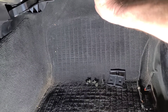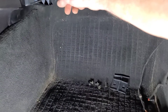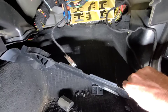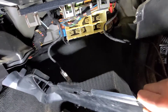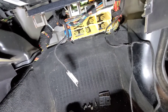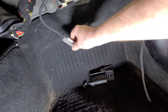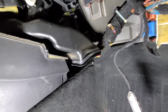Now we have to pull this piece out of here, and that resistor is up in that area in there. Remove this plastic panel by prying it out gently from the right hand side — it's clipped onto the left hand side. Then there's a lamp housing with a cover over it. You have to pry off this little black plastic cover, and then you can take that out. Now we've got to get up into this area where that final resistor is.